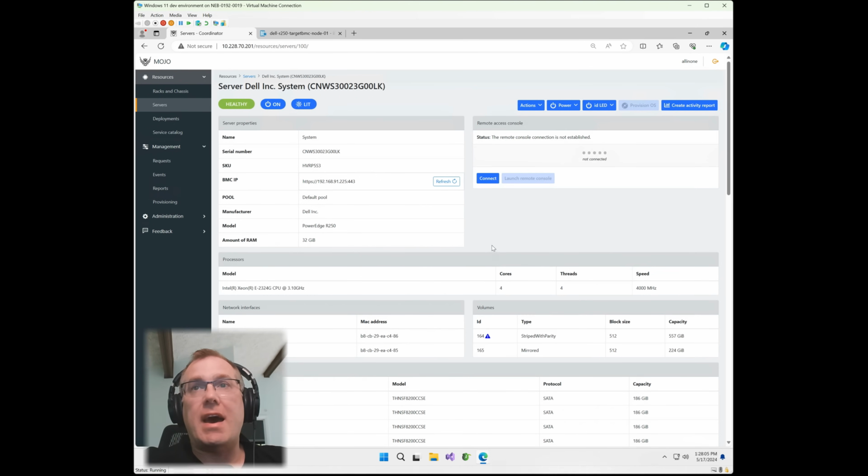If you want to take, let's say, iDRAC up from version 6 to version 7, you do that. It would schedule a job just like we did with provisioning, and then it would allow you to update that firmware. Now, you can do that on one system. You can do it on bulk systems. We pretty much allow that through the standard UI or the API here.